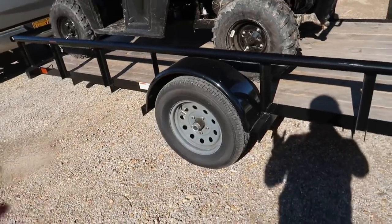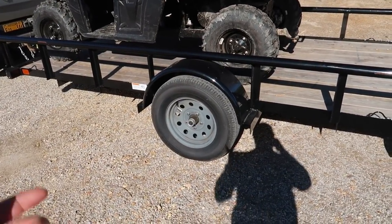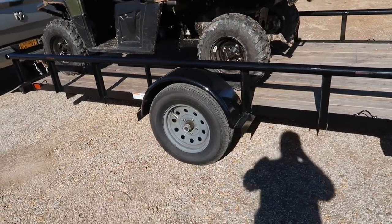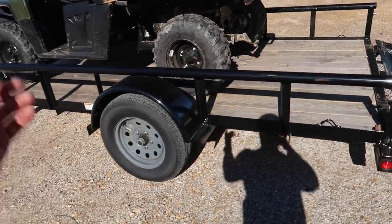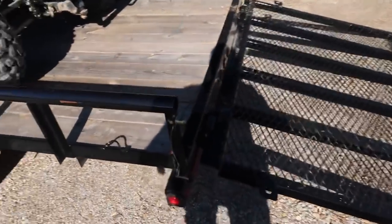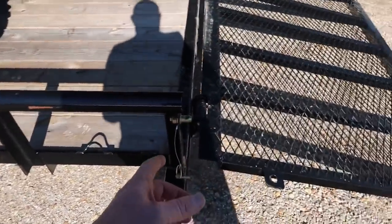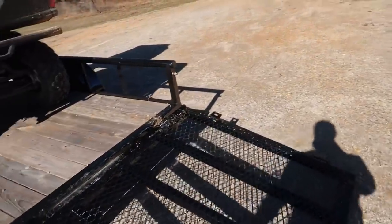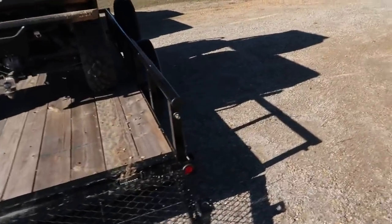But so I went over everything. If y'all ever get a new trailer or anything, go over it after you pull it just a little bit. Go over the lug nuts. The lug nuts need to be retorqued. I mean, every one of them was off on it. So I went over them. These got a little bit of adjustment in them there. Made sure those were snug down. Go over all that stuff, man. Don't just pull it down the road.